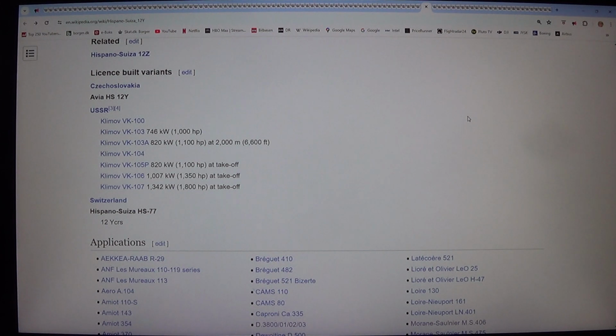12Y50 1939 7.0 1000 2500 1100 0.67. 3260 492 Y, SP, Supercharger LH rotation. 12Y51 1939 7.0 1000 2500 1100 0.67. 3260 492 Y identical to minus 50 but RH rotation.